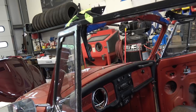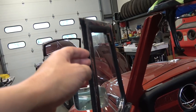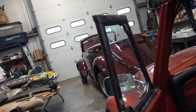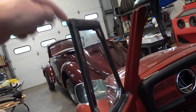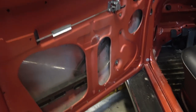The issue we had — just like on the sedan — is I bought brand new felt channels for the vent post. Once I hooked it all up and started winding the window up and down, it was so super tight that it was pushing the felt out. The new felt on the market today is just too thick and the glass doesn't want to get into it. So I made my own felt — I have a video on making your own felt for vent posts — and had to take the whole door apart again to change it. Do this before you insert the vent window.